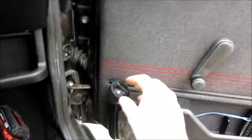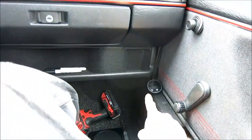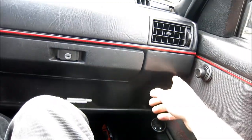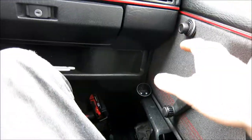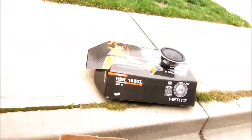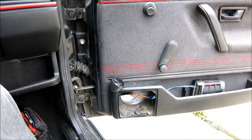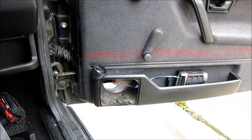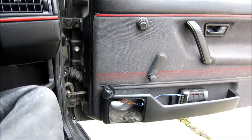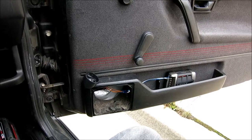As you can see, that's in. I've put the tweeter right here, because we don't want the tweeter aiming at our feet. If we close the door, she's going to hit you — but it's going to hit probably here and deflect a little bit before it hits your ear, which is a little bit better. If it's screaming right in your ear you're going to cry, especially since we're using Hertz HSK165XLs — these things are loud. I've used them on a couple of builds on my channel, and trust me, they hurt if they're aimed at you. We're going to be probably wiring them to zero. You can wire them to plus two — if you like pain, go right ahead. I highly suggest amping these speakers. Today we will not be, but when I do amp them I'll give you another video on that.